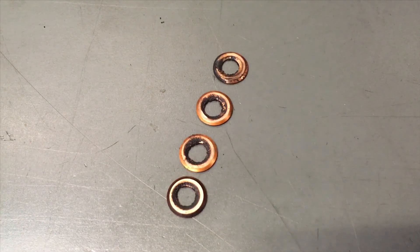There are the seats — they're leaking, they should have been out of engines. 2005, 6, 7, 8, 9s — they should all be done already, years ago. We should be working on making sure 2010s, 11s and 12s are getting done now. From 2013 onwards, depending on kilometres, they're probably okay — start saving. Seven to eight years, thereabouts. If you're not sure, give me a ring — I talk plenty of people out of changing their injectors. Let's have a quick two or three minute chat and I'll give you a rough idea of when you need to change them. The number is 0490 261 013.